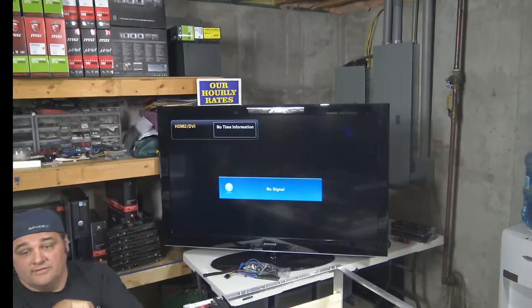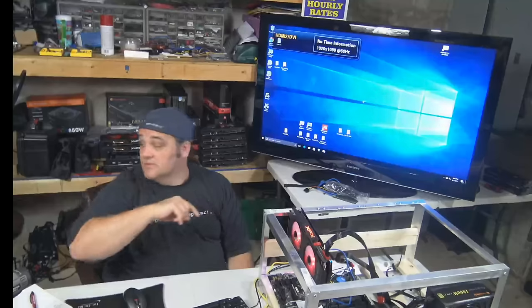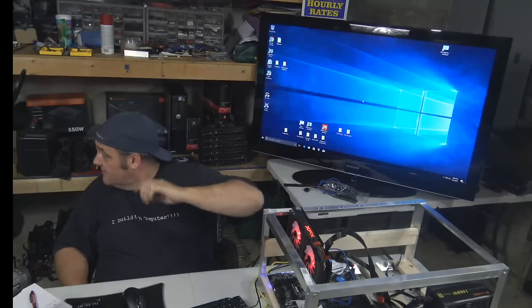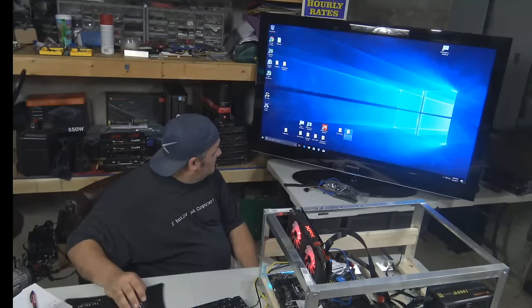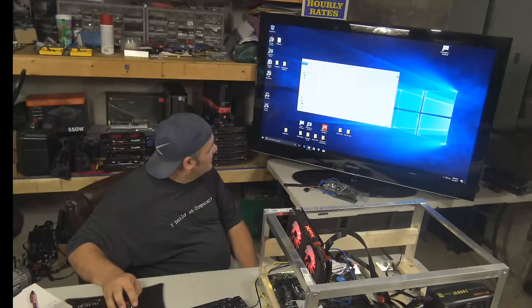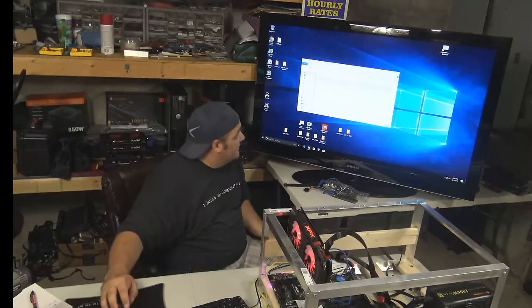Now we'll zoom out a little more and you can see this card. This one lights up all red, has the red LEDs, that part right there lights up. You guys can see that. On this one it was pretty much straight to the point, and I'm going to have the four settings like I did on the other one. Right here, I just did the two, 2125 and 2200. I'll put the 2150 and the 2175 BIOSes out there for you guys tonight.